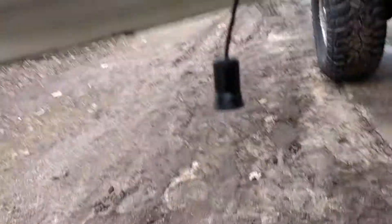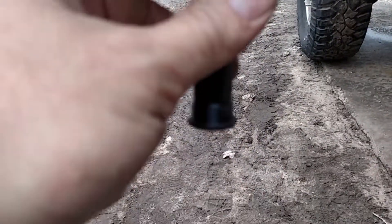How do we drill the hole in the bottom of the door? What I've been doing is go from the edge of the body and then come over 20 and a half inches — that's just the way it worked out. I make my mark, then I'll come out 20 and a half inches, make the mark, and then put the hole in. My hole is made. I've got my O-ring on the end of that thing so it fits in there nice and snug.